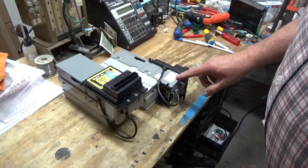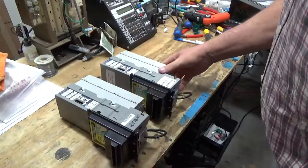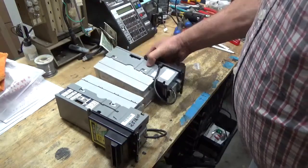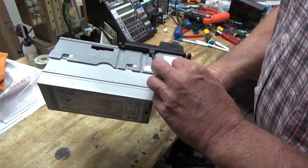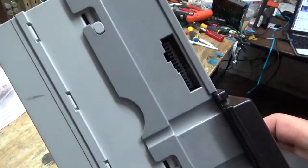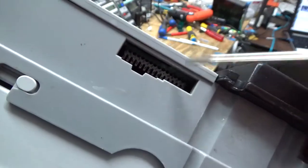This has our current sticker on it, and so does this one. Both came from us — they should both be 25X1s, 110 volt. This one here is odd. Let's take a look at the connection. Here's the problem — I doubt you can see it, but I'm going to point to it. One, two, three, four — the fourth pin on the right is bent over.